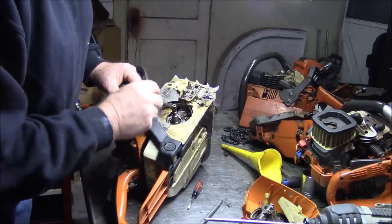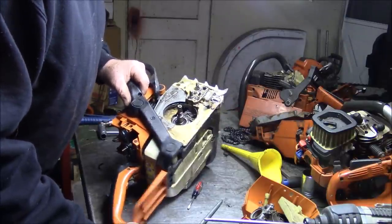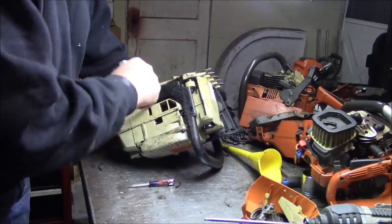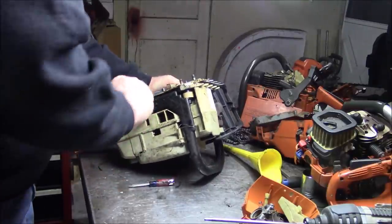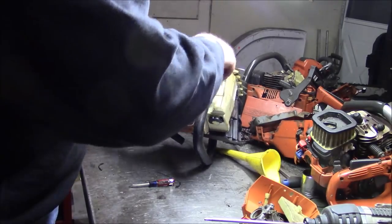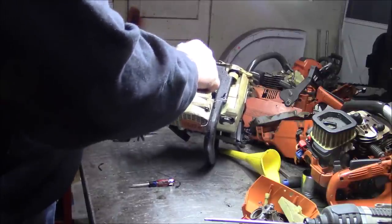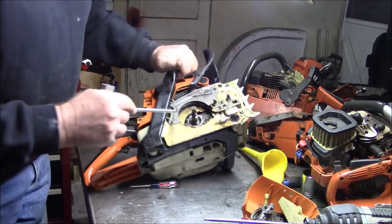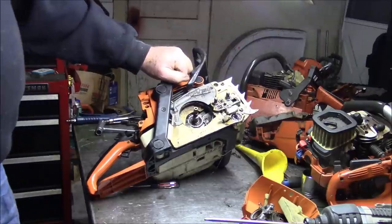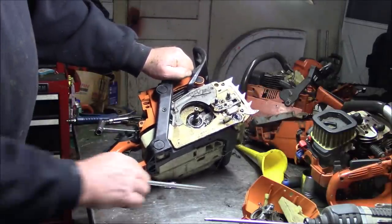Boy, if I'm reading this correctly, it looks to me like someone attempted a repair on this. Boy, I wonder if we could just tighten up on it and make it run. That is loose. Interesting. But the whole bottom end's loose. Not the seal at all, even though the seal doesn't look good. I'm betting it's just sealing up that bottom end. So my hunch is if we take this apart, assuming the top end has a little life left in it, and then seal up that bottom end, we have a saw here. That's what I think we have.